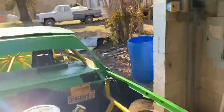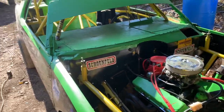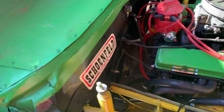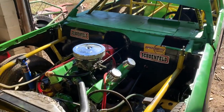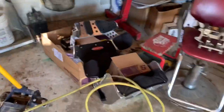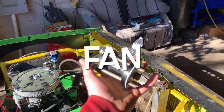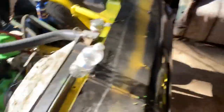That stupid starter — oh my gosh. It sounds terrible. I was crawling under it worried it was going to start eating the teeth on the flywheel, but it's all fine down there. The starter is a little worn from starting like that but nothing to worry about — we just gotta shim it up a little bit. For everyone that's been commenting about the flywheel, we got another spacer to throw on there and a bunch of washers, so that will be taken care of.